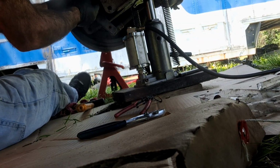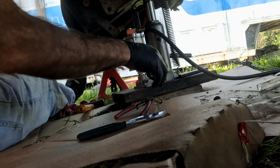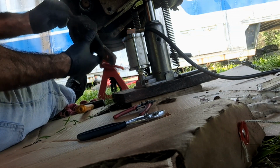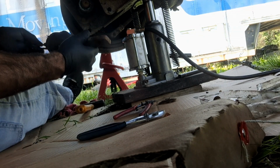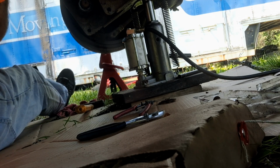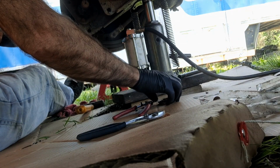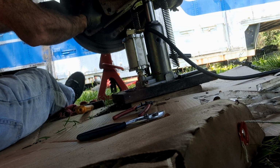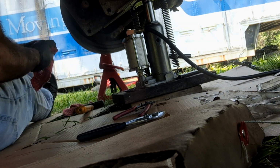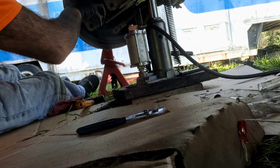Snap ring, 3 washers. All this comes new in the kit. That's all there is to it, to replacing a slack adjuster. I'm going to save this one because where I put it, I don't want to get it all dirty. I'll stick it up here. Then you got another washer. There's another snap ring in here, and it's a bigger one, so you can't mix them up.